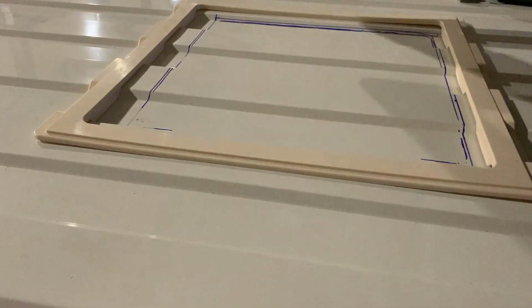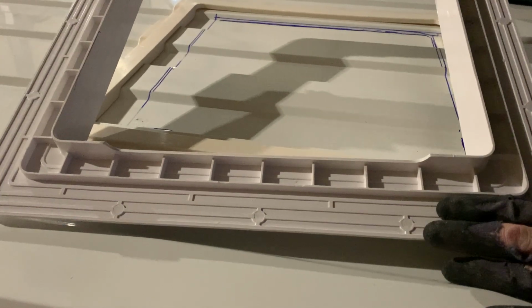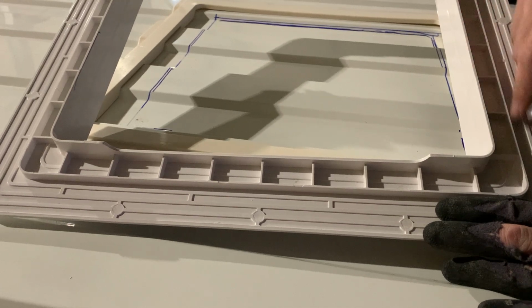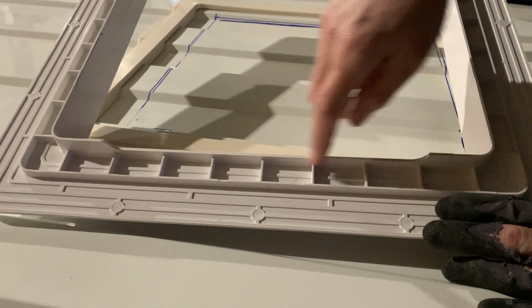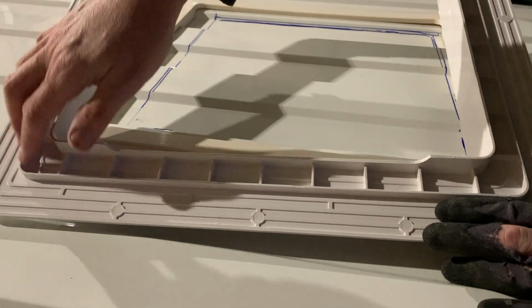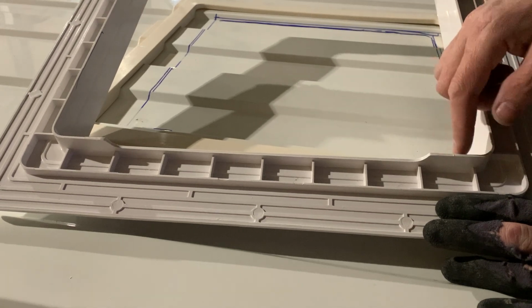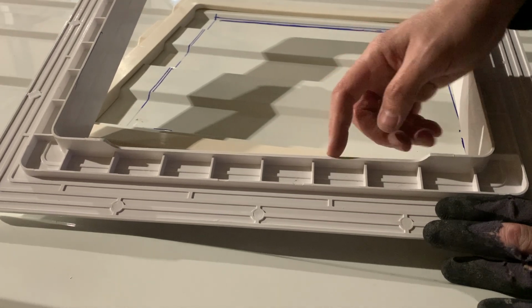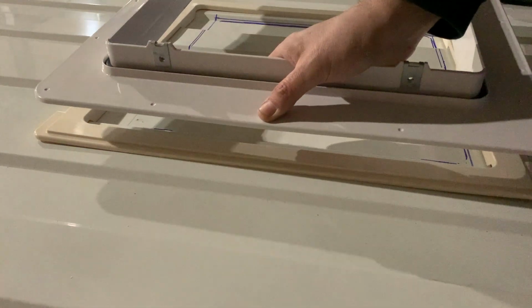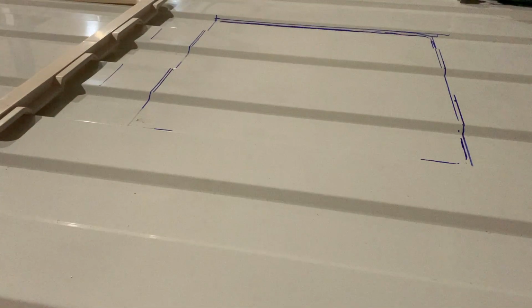And the problem is, on the box of the Maxxair fan, it says cut a hole 40 centimeters, and that's 40. This here's 35 on the inside. I don't understand why we have to cut a 40 centimeter hole. So I'm just cutting slightly wider than this 35 and a half. I've marked it. I set this in at the exact spacing that I need. So we'll see how it goes.